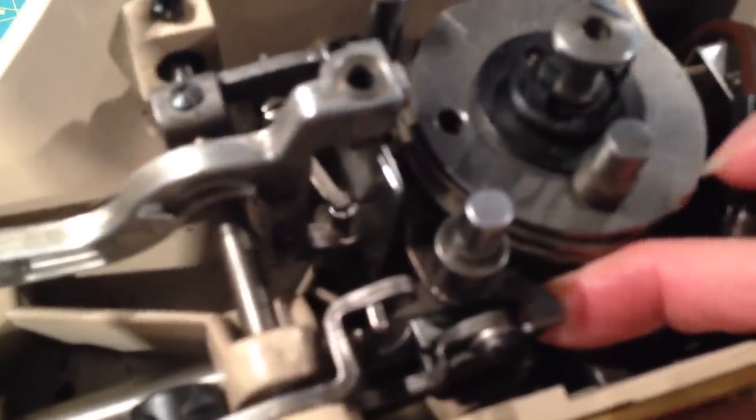By clearing that pillar, we can slide up and we can slide down to adjust the stitch that we choose. Now, in order for all of this to work, we need a couple of things to be working correctly. First, these can't be stuck together. Second, there's a bunch of linkage here. You're going to see there's a joint here, and there's a joint actually down here below the collar. Let's just see if we can get it to, there you go, that pivots around. We need to make sure that those are free moving. If they're not free moving, then they can't elongate and get shorter as we turn these up and down. If they can't do that, they're effectively stuck.